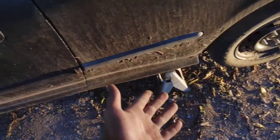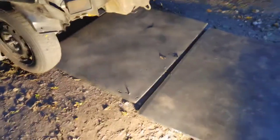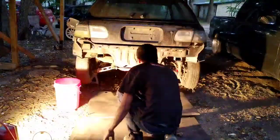And yes guys, I do have chocks up front, and before you climb in, you better shake it, because you'd rather it fall, just, you know, maybe it might bend your jack stand or something. But better to do that than your car fall on you. Hold on. There's not really going to be that much light in here, guys, but once you undo these Phillips, you pretty much do the same thing as you do to replace your fuel pump. You undo those lines and everything should come right out. But I'll see you guys back on the tripod, time lapse this, and we'll get this gas tank out.